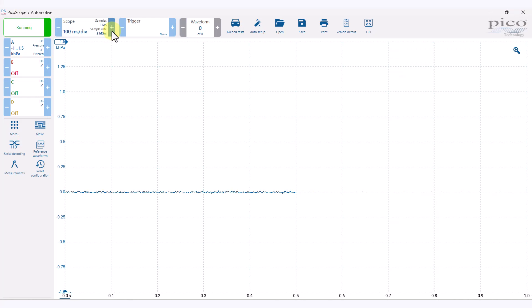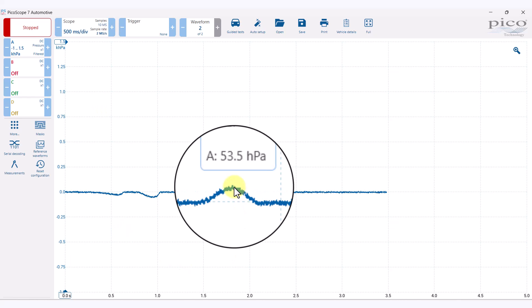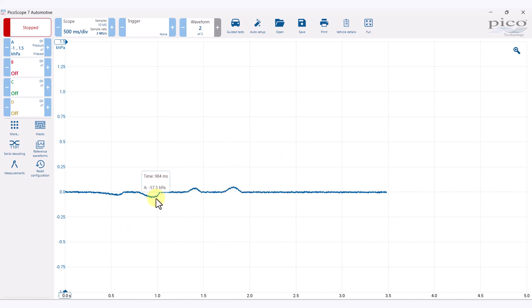If we just turn the time up a bit there to see it over longer — it's pretty sensitive. We're looking at small pressures created by me, around 50 millibar, so it'll be interesting to see how it works with really low stuff as well. It's suitable for petrol compression and fuel systems.